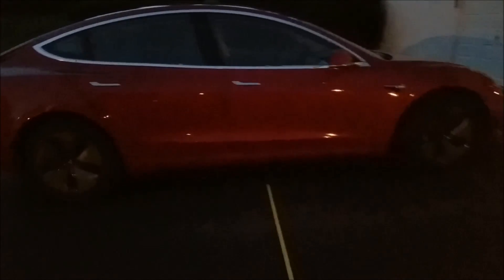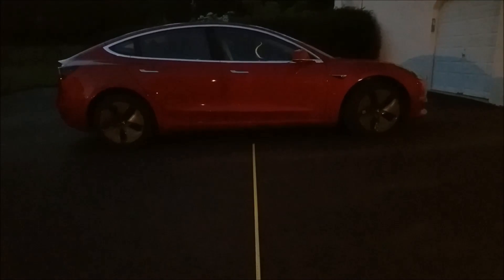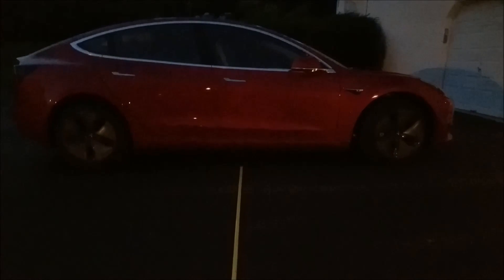We're on the right side of the car. I'm at 14 feet from the right side — locked. Going to 12 feet — still locked. Going to 10 feet — it opened at 10 feet. Coming back to 11 feet — still unlocked, unlocked at 11 feet. Just heard it lock, so between 11 and 12 feet on the right side it locks. Double checking at 12 feet — yes, locked. So between 11 and 12 feet on the right side it locks.